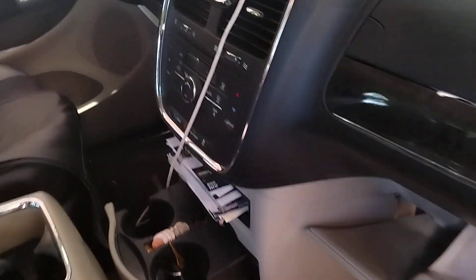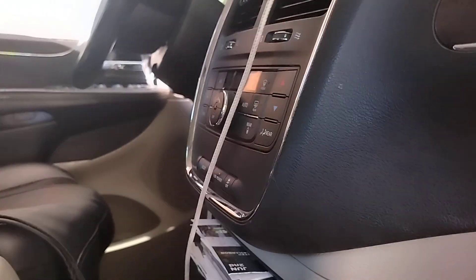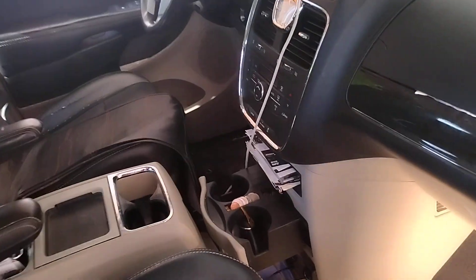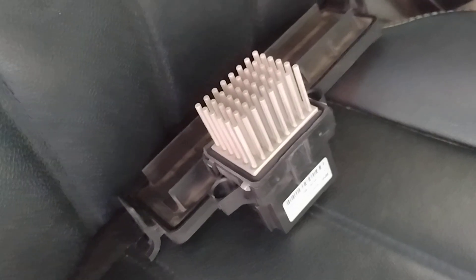Unfortunately I can't get it to act up right now — I've turned it off and on, tried the heater off and on, even had a wasp flying around my head while checking. I've watched the actuators to make sure it's not a blend door issue, and all of that is working. So I don't think it's a switch issue or a blend door issue.